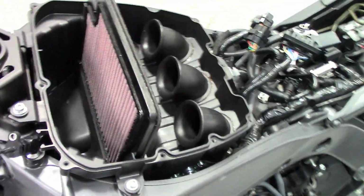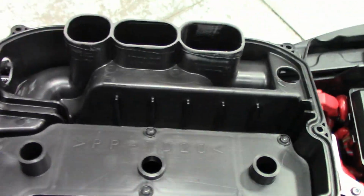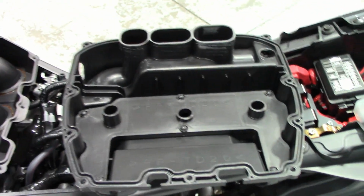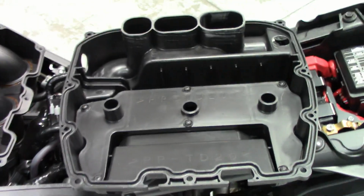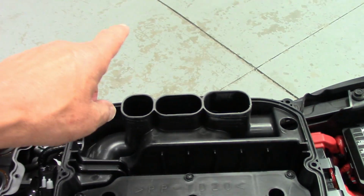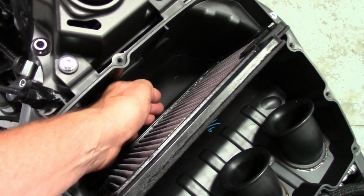Okay. And now I've got the airbox lid sitting here. Instead of those snorkels, hopefully you watched my previous video of pulling this apart and modifying the airbox. I'll put a link in the description of this video. Anyway, these used to stick way down in here, clearing the bottom of the airbox, a lot more restrictive. So now they're like that, and just slide it on very gently.